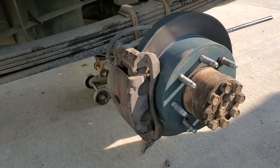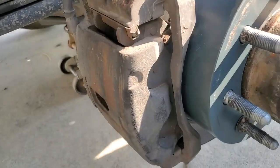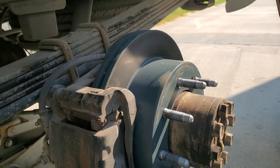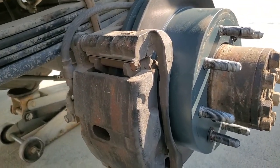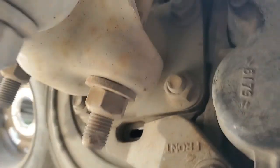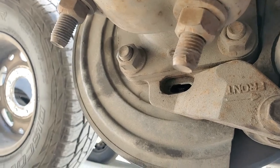Today we have a 2007 Chevy Silverado 2500. We changed out the rotor from being warped and found that the seal was bad, so we changed the seal and parking brake shoes because they were totally saturated with oil. Afterwards, we discovered that the parking brake was misadjusted.